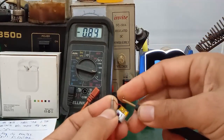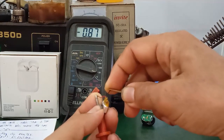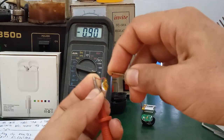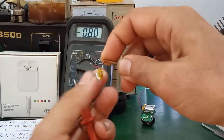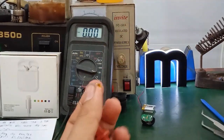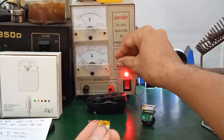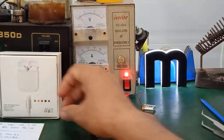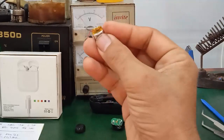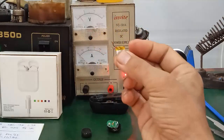Let's say the battery voltage is very low — around 0.9V — that is too weak. In this case, charging won't work and you must kick-start the battery. To kick-start, use a phone power supply, slowly increasing the voltage. For most Bluetooth earphone power loss issues, it is usually a dead battery. If kick-starting doesn't work, you must replace the battery with a new one of the same size — if it's too big it won't fit in the earphone housing.